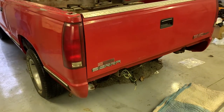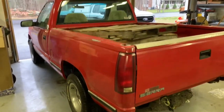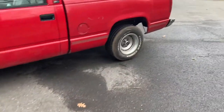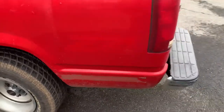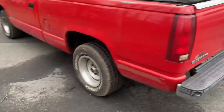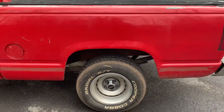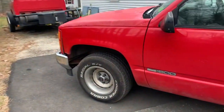Hopefully this video helps some people — if you have any questions just leave them in the comments and I'll do my best to answer them. Been driving this truck for about a week now, everything's good, really no complaints. Still need to get the driveshaft made. Attaching the bumper brackets did not suck the frame in like I thought it would, so the rear suspension is still pretty bound up. I'm going to have to pull the bed off when we do the C-notch and make a cross member to take care of that. Still need to do parking brake cables, then we'll be pretty much back to where we started.